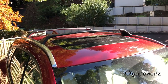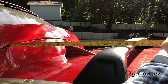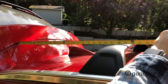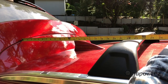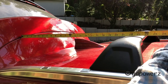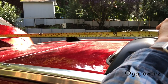It's all tightened down and ready to go. Next step is the cargo box — that will be a separate video. When I was shopping cargo boxes for this car, I had a hell of a time finding the rack dimensions. The center of the rear crossbar is about 22 inches in front of the hatch when you lift it up. The crossbars are roughly 28 inches apart on center.